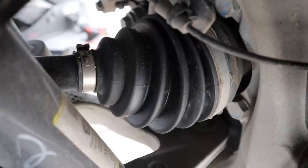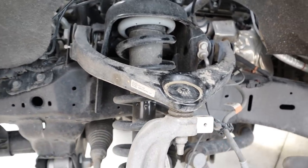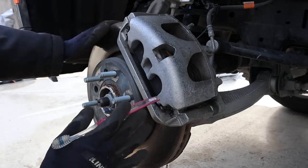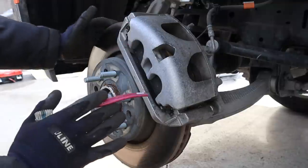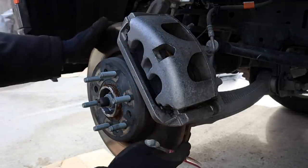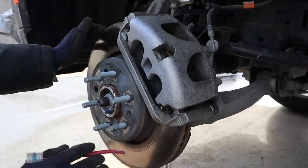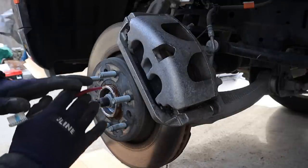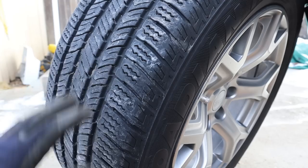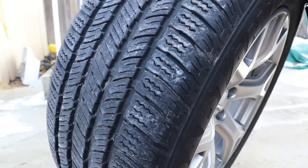Here we've got the inner and outer tie rod for your toe adjustment, and a look at those bolts that bolt the bearing onto this aluminum knuckle. I also see a little ball here as well as a tab with a threaded hole — probably for features we didn't get, like adaptive dampers or the air suspension system. Taking a look at the brakes from the outside, I think they really cut costs here by only going with the two-piston design — they should have upgraded to a four-pot or six-pot. You could probably get away with this on a Chevy Equinox, but on a big body-on-frame V8 SUV like this one, it really isn't going to cut it, and you can kind of feel it when you test drive. The same goes for the tires — there's no pretense that this could be an off-road vehicle; it's the same tread pattern you'd find on a Chevy Cruze.